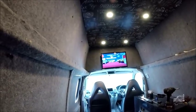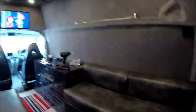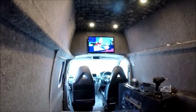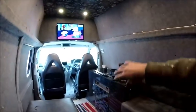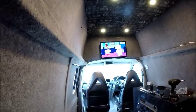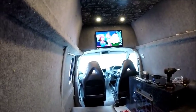And there we go — that's how I fitted my 24 inch Cello 12 volt TV. I hope you found this video useful. If you did, give it a thumbs up, and if you haven't already, hit that subscribe button below. As I say, I've documented everything on this van job by job. This itself has taken probably not even half an hour. If I'd had to run the cabling at this time it would have taken a little bit longer, but I'd already thought ahead when building the overhead locker and planned to have a TV in there, so when I was running all the electrics earlier in the build I did run some cabling up there in preparation. Once the cabling's in, it's just a case of putting the mount on, chopping the end off the TV plug, hardwiring that into the 12 volt system via a fuse, and there you go — the 24 inch LED TV is fully working.